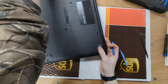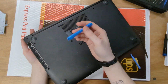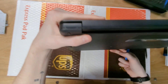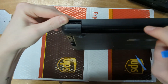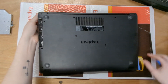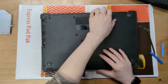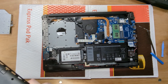Make sure it's a little loose and then do the same on the other side. If you don't have a spudger, you can use a metal tool, but be aware you'll probably scratch the plastic. Push the spudger in, pull out, and then you should be able to wiggle the panel. Pull up and you're in.